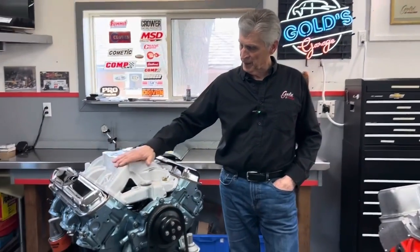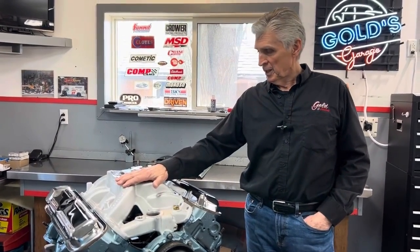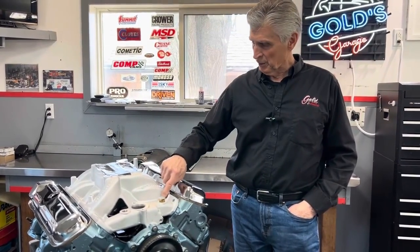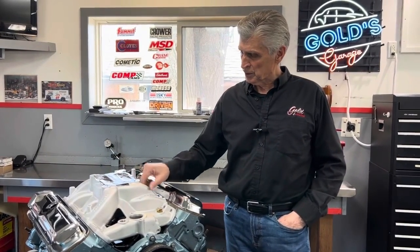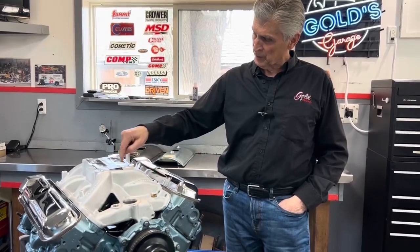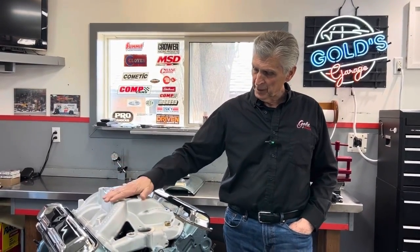So typically to achieve that — and this is an Edelbrock for a Pontiac, obviously — it's basically based on the original stock manifold. You have one port that goes down under for number one cylinder, and the other one goes in the top for number three cylinder, and then that gets duplicated in all the other four corners. What that does is essentially makes the port that reaches this valve start farther away, and the port that reaches this valve start shorter. That makes these intake runners about the same length and as long as possible. The limitation, of course, is you can't make the manifold higher — it won't fit in the car — so they're trying to make the ports as equal length as they can, and for a street application, as long as they can.